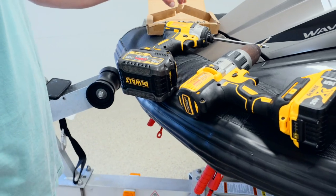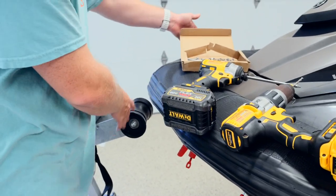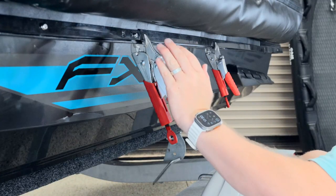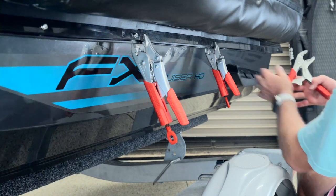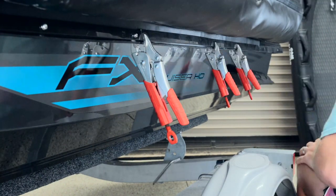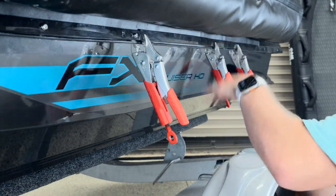We're going to work from the front to the back. It's super important to use more hardware to reinforce the front — those two brackets, one here and the other backer bracket on that side. As you work on the ski, it's super important that we use vice grips the whole length down — the more the merrier. I'm using four in each section so I know it's nice and taut when I'm drilling through it, and there won't be any mess-ups or sliding.